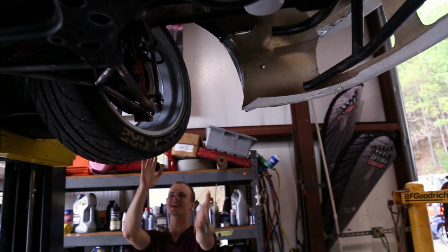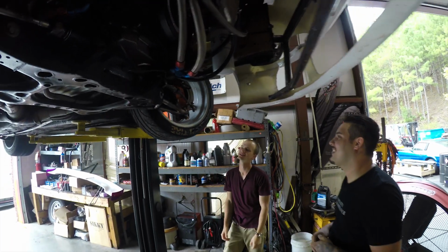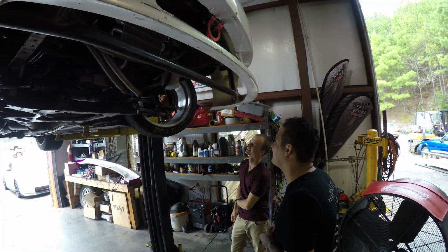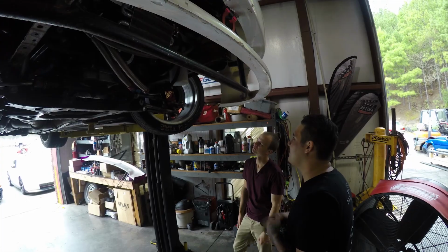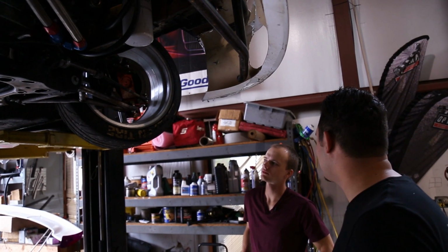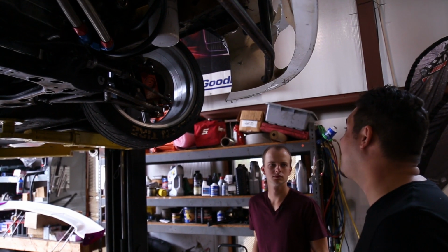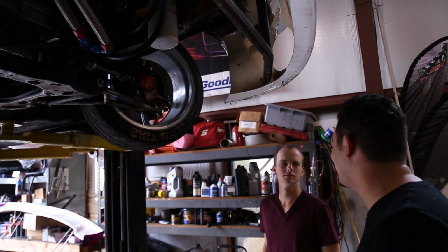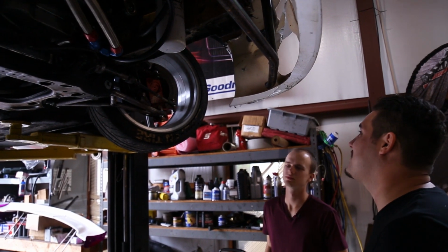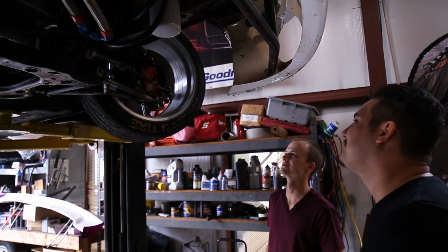That's ridiculous, like as close to 90 degrees as you can get. It is, we measured it. It's about 70 plus degrees, depending on what spacer and offset we run with the wheels. With different tracks and different layouts, we play with running a little bit of a spacer, so you can control the swing and sweep of the steering, which is another big thing. There's so much design and geometry that goes into it that it's hard to wrap your brain around. Yeah, absolutely.